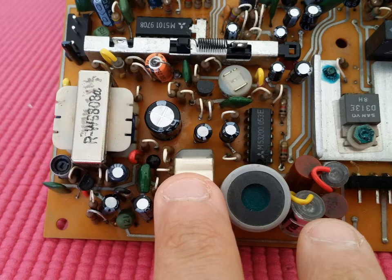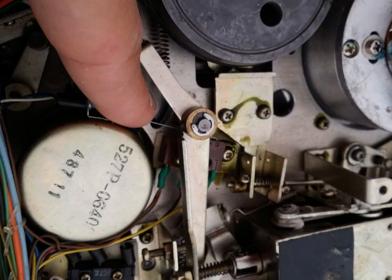I try to record in slow, then play that audio back and it just flies through the machine — so it is definitely a motor speed function problem, which is what I'm working on right now. I just got done recapping the entire board.